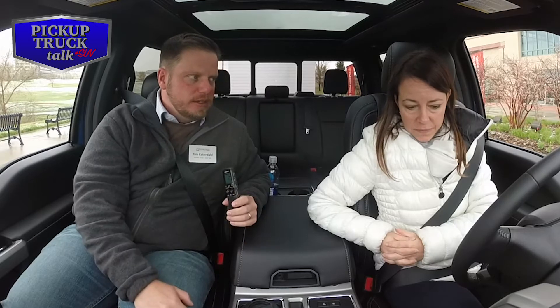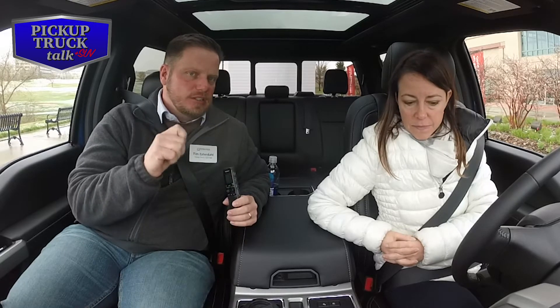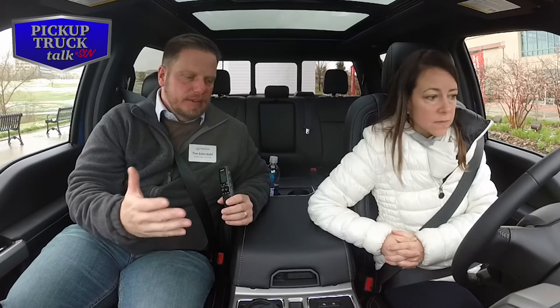I felt it when I was in the passenger seat. And I was going to ask you if that was normal. It's very normal when towing. You can adjust that a little bit — we do have a trailer brake controller in this. What the trailer brake controller does is actually add additional braking force to the trailer and makes it a little bit smoother. But it's just part of towing. You don't get freaked out about that. You will have some times coming off the line where you'll jerk a little bit — that's some of the acceleration trying to pull the load smoothly. It's really not that big of a deal.